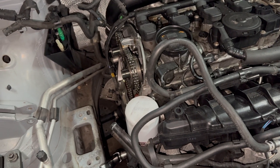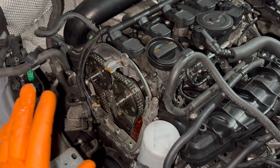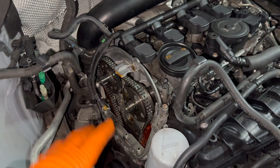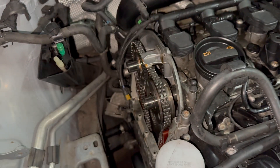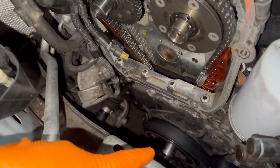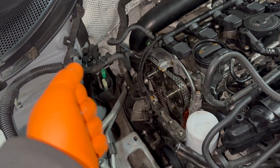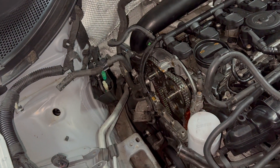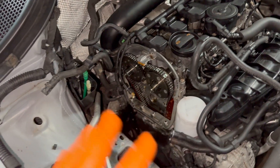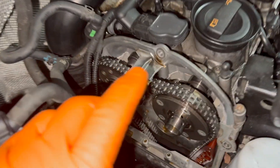A simple way to diagnose this — I have videos on how to take it off, and I'll put them in the link — to do the timing chain check you take the cover off. If you're having these problems, you have a plastic cover here with hoses; take that plastic cover off and crank it from the bottom. When you're cranking, if it hits something or feels solid, stop — your timing chain tensioner failed, it jumped time, and you've smashed valves.